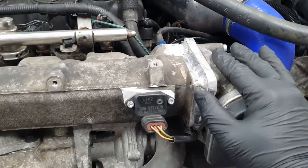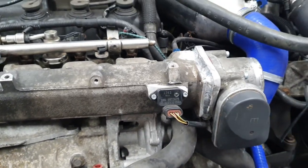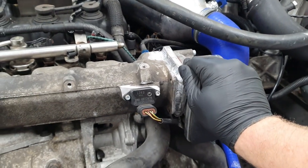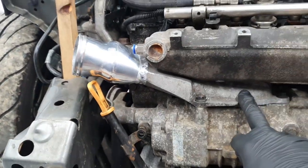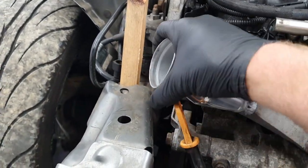You can see here the throttle body — we've obviously moved it from pre-charger, which is where it was and where all the R53s are. We've got lots of reasons for doing this, one of them being the cost of our boost pipework mainly. There's the second horn which was remade there, and we've got a brake takeoff here with a nice round boost pipe coming down there.